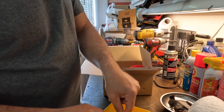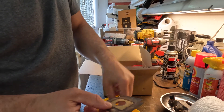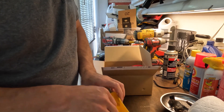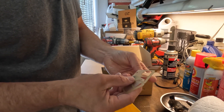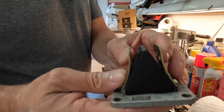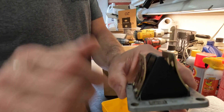See guys, this is the old one — you can see it's broken. We still have the gaskets; I'm going to try to reuse these and might put some gasket maker on there. The actual reeds themselves look pretty good. I'm going to take the reeds out of this new cage. You can see that this reed right here isn't sitting flush — it should be flush like this one. Easiest way to fix this is to flip them around.